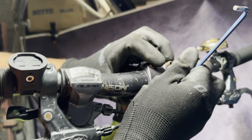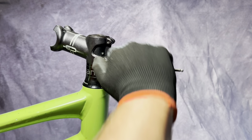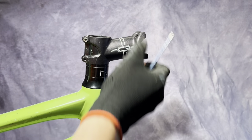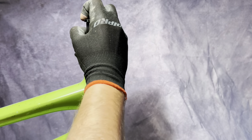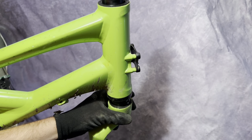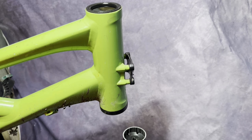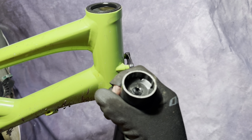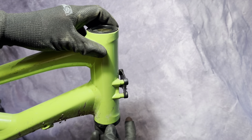We'll be cleaning up the stem bolts. Most of the bike was in pretty good condition. I don't know if this head badge is supposed to be a cable guide, but when I bought the bike some of the cables were behind it which keeps them a bit tidier. The steerer tube has so much chunk to it - I think it's a one-and-a-quarter-inch one. Luckily the headset was in good condition so it doesn't need replacing, and it's a steel bearing unit anyway. The steerer tube looks like it was actually cut down as well, but it still has quite a few spacers left so there's enough adjustability.